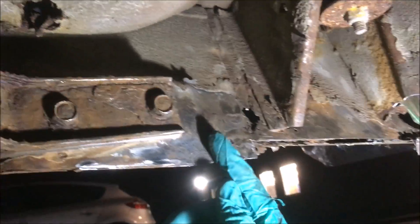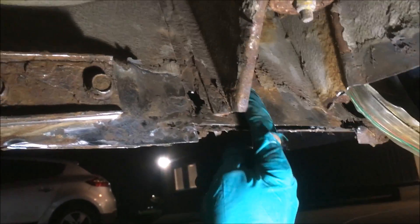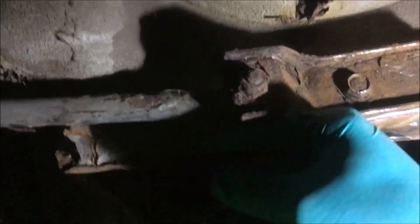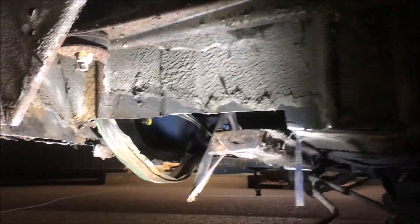This is actually okay — I've chopped a bit off here which I know I'm going to need to fix, but the inner sill is okay up to about here; it'll need a patch in there. That bit's good apart from some frilliness here, but the bit behind is excellent, which is great, and it's fine all the way through until the wheel arch starts. So that's good news.